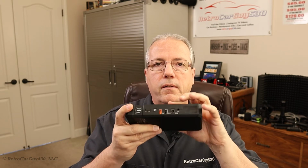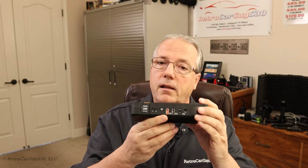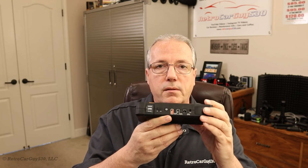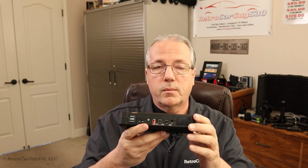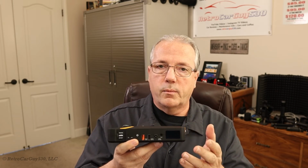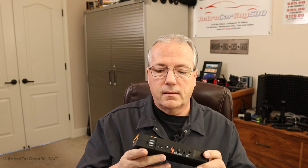It has the 5 and 9 volt fast charging port, so if you really need to charge something that's a USB charge-based product, you can do that, and as I demonstrated with my example phone, that one will go into fast charging mode when plugged into that orange port. The 12-volt power port works and does supply the proper amount of amperage to run that tire inflator, so the 12-volt 10-amp rating seems to be reasonably correct. The LED light actually seems to work well enough to supply usable light. I went out into the garage this morning and had it completely dark in the garage and turned on the light, and I could see reasonably well, so if you need to use this while jump starting your vehicle, that seems to be a decent enough feature.